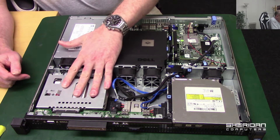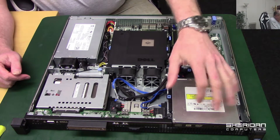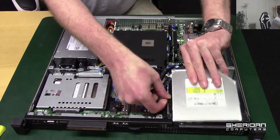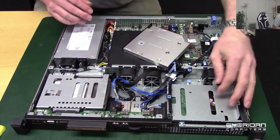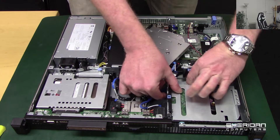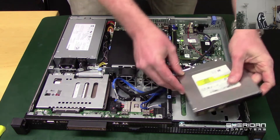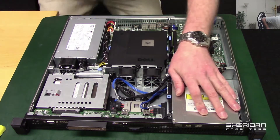One's located here which is the main drive, and the secondary drive is located under the CD-ROM drive. I'll show you how to get to the secondary one - lift that down, it'll come out, and then basically there's a lever here. If we pull that up the drive will pull back and it's out. I'm not going to do it again because I've already done it a few times. Stick that back in.